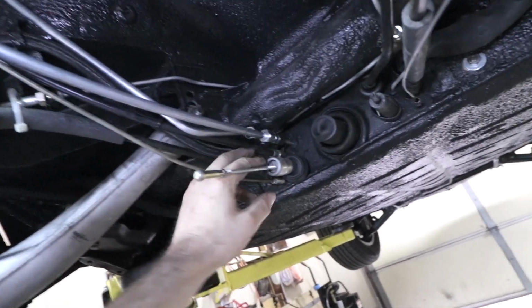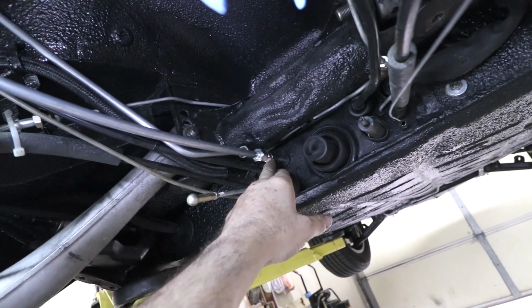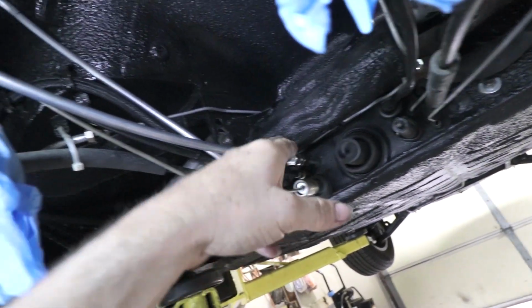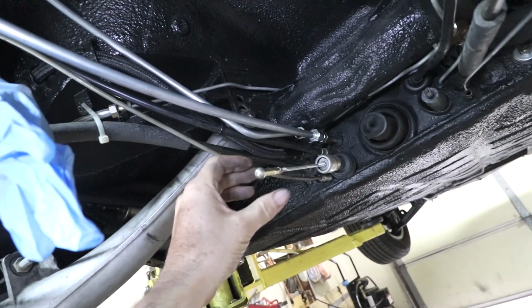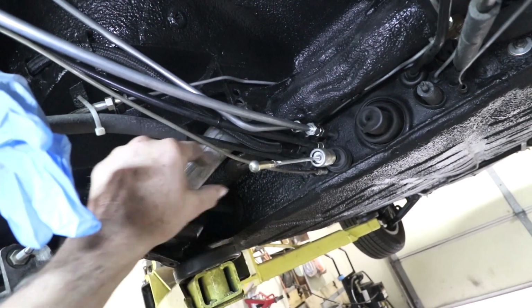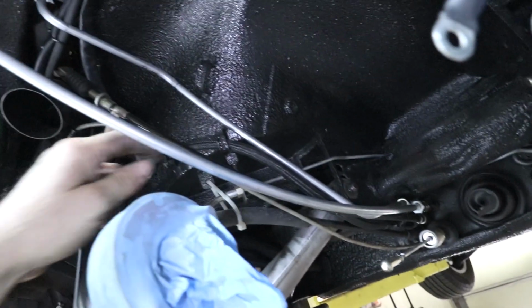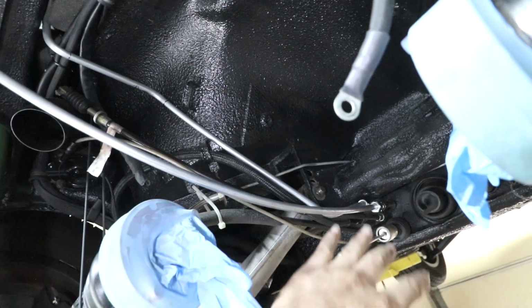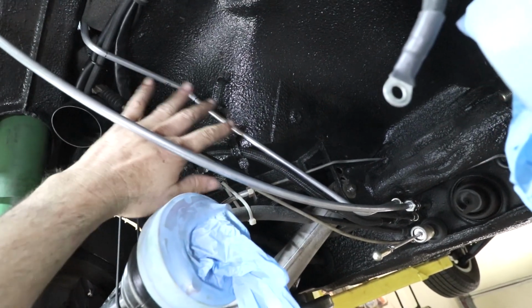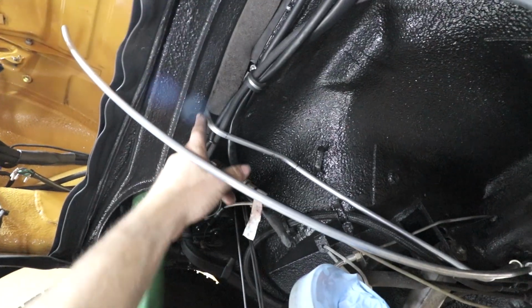It's loose, but that is going to replace this tube. That's just temporary. It's going to fit right there to the tunnel fitting, and then it's going directly up. I know it's going to clear the bell crank on the transmission. That's where this goes. That's going to be like right here. So it turns up quick enough, tucks in between these two clamps, which I can then use hose clamps. This part of the car does not flex at all, so it's okay to secure it down tight, and then it goes up into the engine bay right through there.